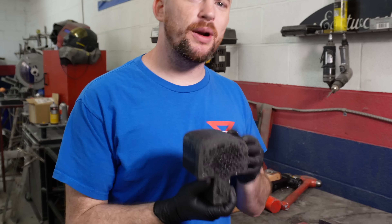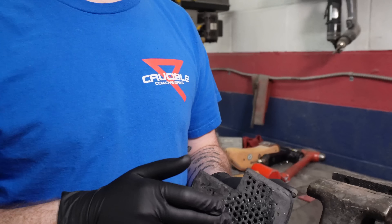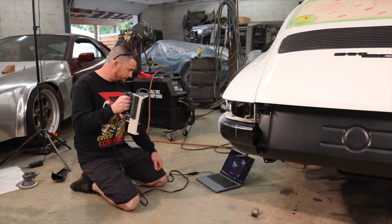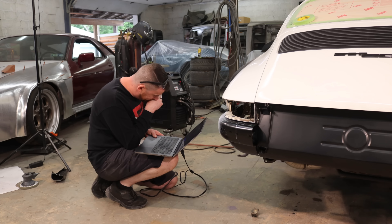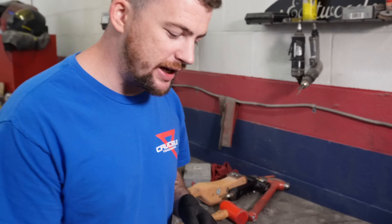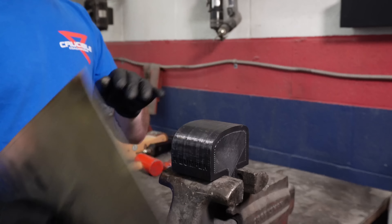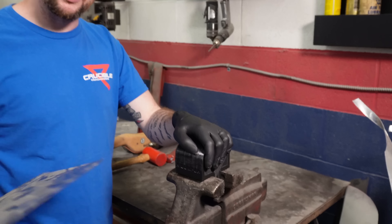This works surprisingly well. I wasn't sure what was going to happen if I didn't print with 100% infill - it was like 50% infill with the triangle hexagon infill. I did 7 perimeters, wall shells, with a 1mm nozzle. We used the Creality CR Scan 01 3D scanner to get the form and I printed it on the Creality Ender 3 S1 printer. Now I can use this hammer form again, and I already cut out the piece, so I just have to trace the major feature lines and begin shaping the metal for this bumper flare.